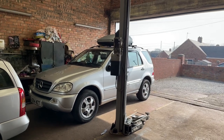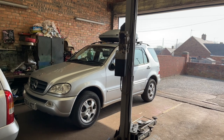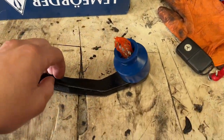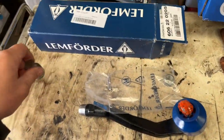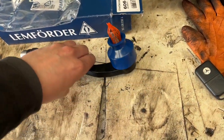Welcome back to Project ML. As discussed in my daily vlog, we're going to crack on. It's taken us over two weeks to get my Lemförder track rod right. We've done the winter checks and the only thing it needed from coming out of winter was a bit of play in the front track rod end. We've got the new one here — this is original equipment, exactly what you'd get from Mercedes. I don't want Moog or anything like that — load of crap.